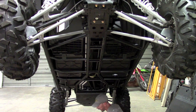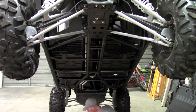We figured it has about a 32nd to a 16th of an inch of compression, so it'll hold the plate tight. But without this bushing, you can still just keep tightening that bolt and it will actually pull itself right through the plastic. So it's essentially just a stop. You can get the plate tight, but you can't keep going after the fact. The ones with the long bushings are going to go to the rear. The short bushings are going to go to the front.